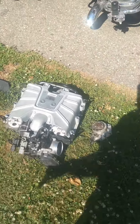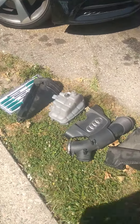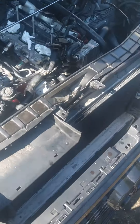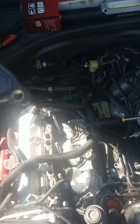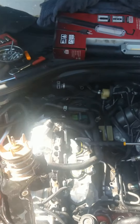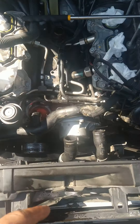Back on that 2013 Audi Quattro A6 3.0 supercharger — water pump and thermostat replacement. Here is the thermostat. You do these anytime you do anything with that water pump, or vice versa. Now to do that you've got to remove the supercharger to get to the thermostat. My last video showed how to remove the water pump.